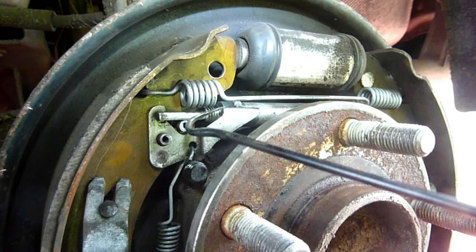Now that's just one point, because if you've got contact between the brake shoe and the brake drum when you're running, you do have a risk of overheating it and causing a fire, or bursting your tire in the middle of the road without having noticed it's heated up so much. And you see in this picture, the piston above, that's just rubber, and that could burst as well. And of course the worst thing is if your tire bursts in the middle of the road.